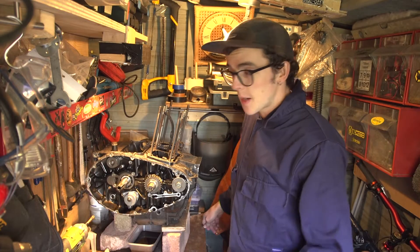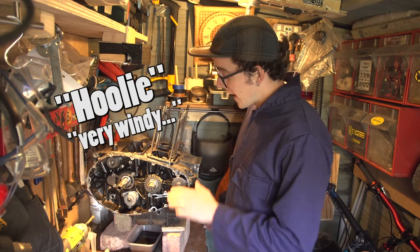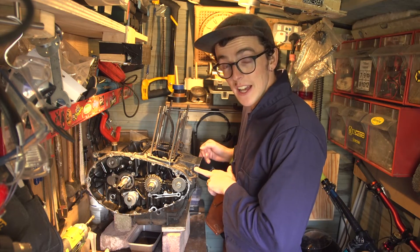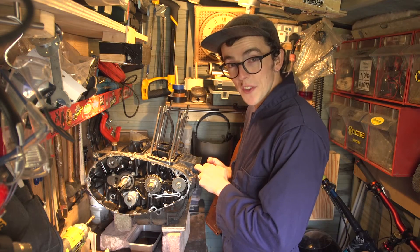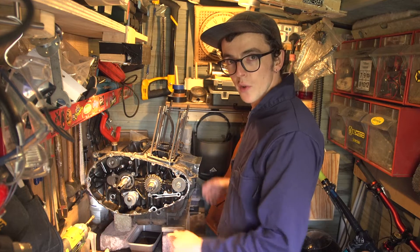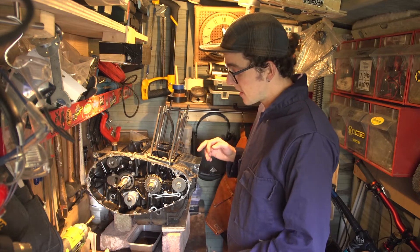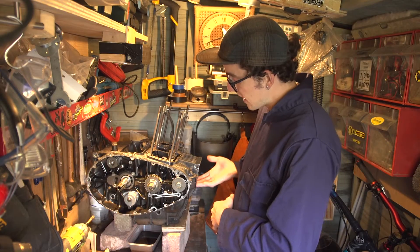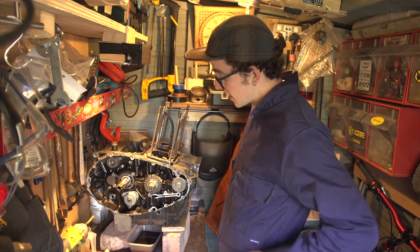Well folks, it's a new day. Apologies if there's any wind noise because it's blowing a hoolie out there — that's a Scottish term, it means very windy. I had a bit of an issue with the front engine bolt on this engine. It basically was seized in place and the previous owner couldn't get it out, so they just chopped it and left the stubs stuck in the engine casing. I wanted to get that out before I separated the crankcases, as it was easier to work on a full engine. The Suzuki engineers, in their infinite wisdom, left a gap under the casing at the front of the bike, so all the road salt and crud from the road comes off the tyre and straight into the front of the engine. It's a steel bolt running through an alloy casing, so it just reacted with each other and corroded and seized up.